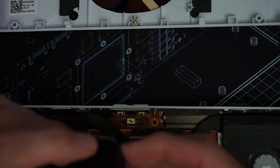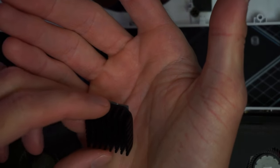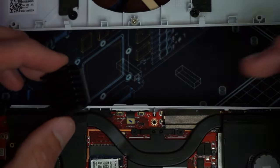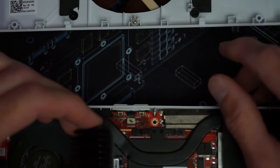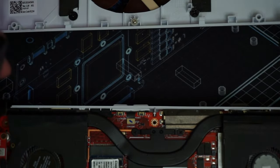What you can do to prevent denting is grind off this little corner right here, and you can paint over it with a marker to make it look pretty. I basically took a Dremel tool and ground it down in the corners so no matter how I put it on, it's not going to hit that. If you use too thin of a thermal pad, it will for sure hit because it'll be lower to the drive. I used a one-millimeter pad. Don't use 1.5mm because it won't close and you'll have a bow on the back plate. Don't use 0.5mm because it's too thin and doesn't have enough squish.